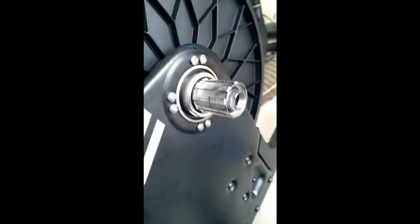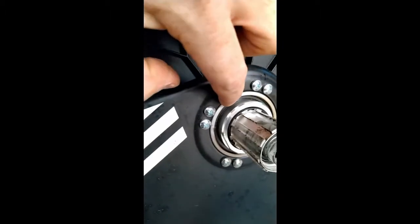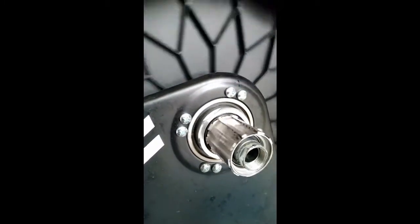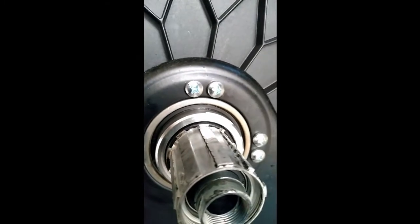However, on this side you'll see two plastic rings. This one here, but mostly the one you're interested in is this one at the back. So I think this is quite a heavy duty bearing that's sitting here, and obviously it's got this plastic race guard in it, just like a lot of sealed bearings. That is where the squeaking was coming from.